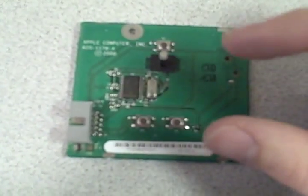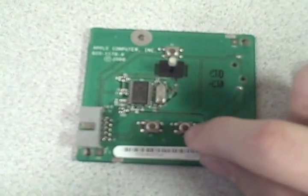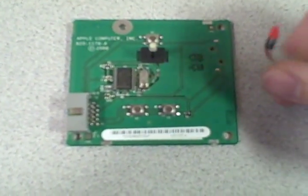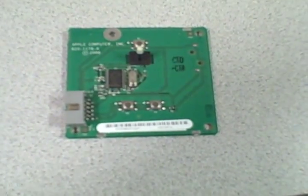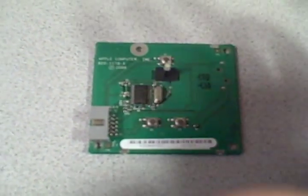It's got a little plastic button about that long — you push it and it reaches through and pushes the switch. I'm going to pull it out and glue in a red LED and make that the hard drive light, since there's no hard drive light on the case. So we'll have a hard drive light now.